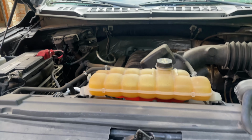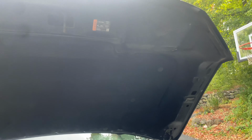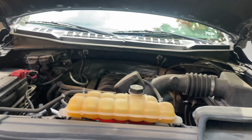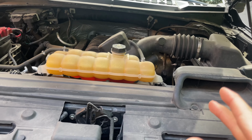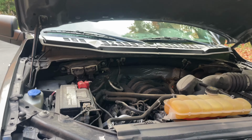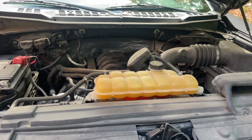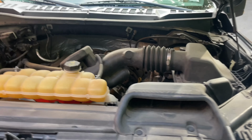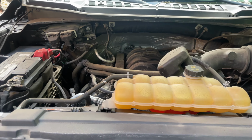All right, so after we drill brushed this entire carpeting piece, we're gonna go over the top piece with the pressure washer only, and that's all. I don't ever like to use the pressure washer running over the engine, but over this top piece, it's fine because there's no electrical components. So we're gonna pressure wash that, and then we're also gonna just mist the entire engine with the pressure washer to rinse it out. And then after that, I'll circle back with you guys.